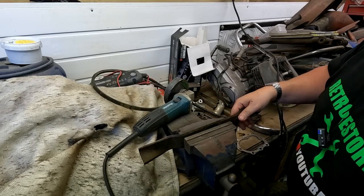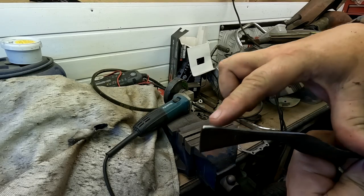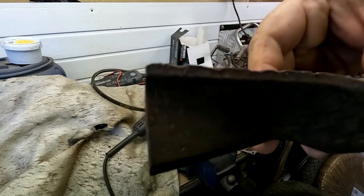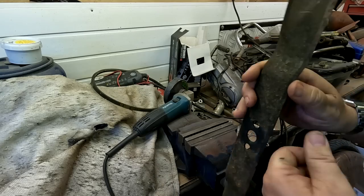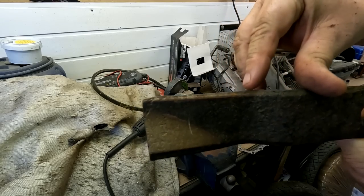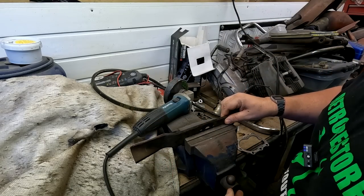And what I'm looking to achieve, I'm just flattening the top off there. Can you see there, look? That's nice and flat now. It was pretty much like that where the top had been dug into. And all I was looking for is just to flatten it off so that we don't have that anymore. I'm just going to square that end off a bit. I'm just going to start from there and make sure that's straight before we go to the next stage.